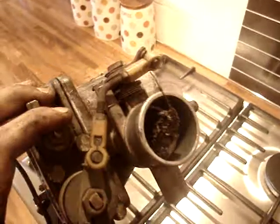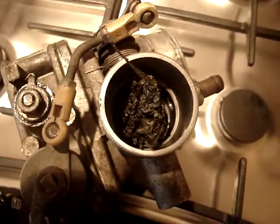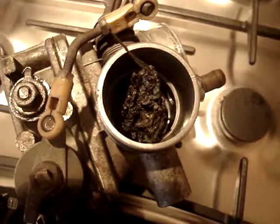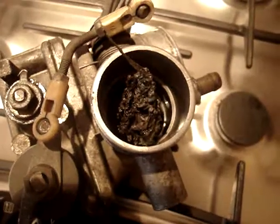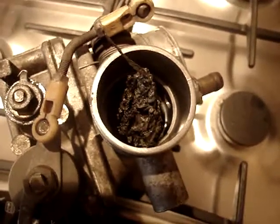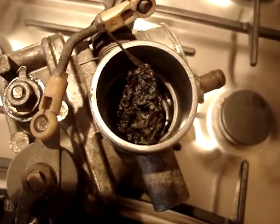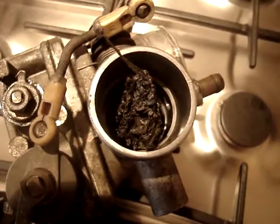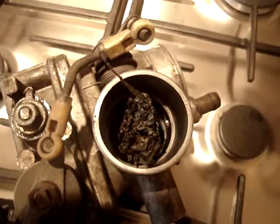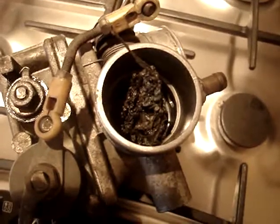As you can see, the bypass line has melted plastic inside it. I'm ashamed — I'm embarrassed to say this — but when I plugged the port on the G charger, I think I forgot to remove one of the bags that was keeping it clean. And in my haste, when I was rebuilding it after the cylinder head went on, I forgot to take it out. I've piped it up, and this is what's happened. And this is the reason I can only raise 6 psi boost.